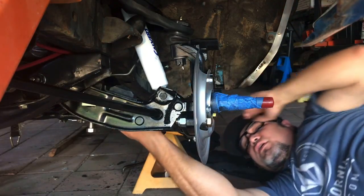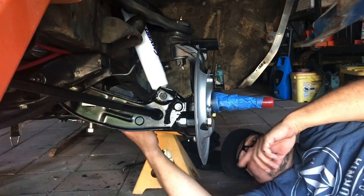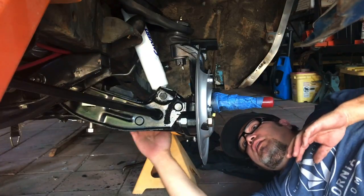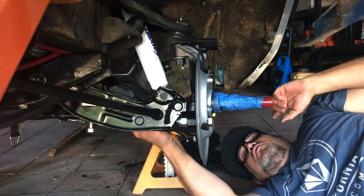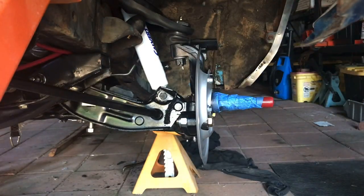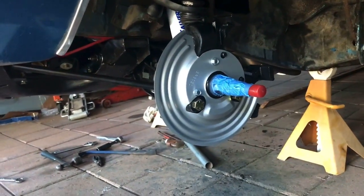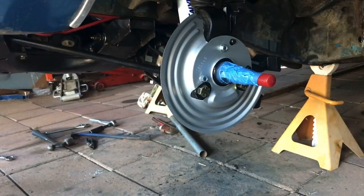Once you get close, you can put some tires on here and do a proper toe-in measurement. I'm not going to tighten down the tie rod sleeve because you're going to have to revisit this — it's just kind of ballparked right now. Get the tires on, along with the rotors, calipers, and brakes, and you can see how far off the alignment is. That's it for today's video — I'll see you next time.